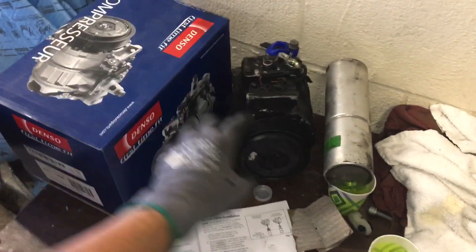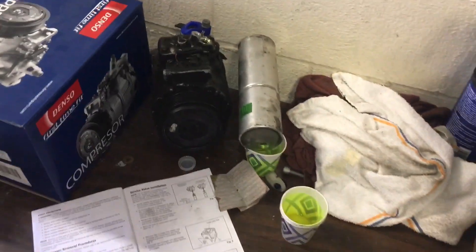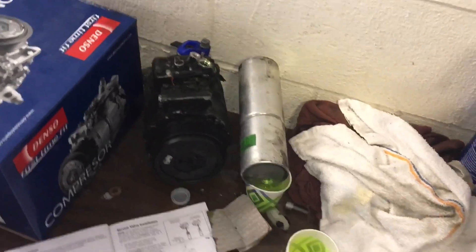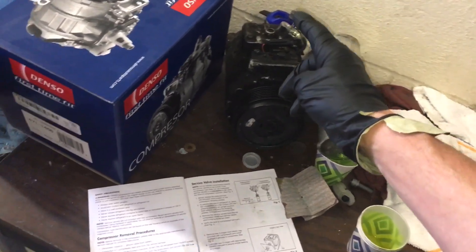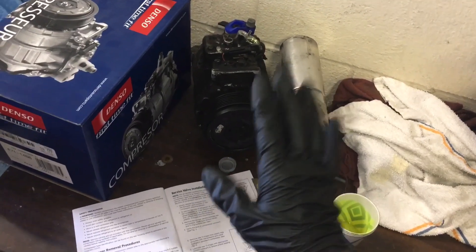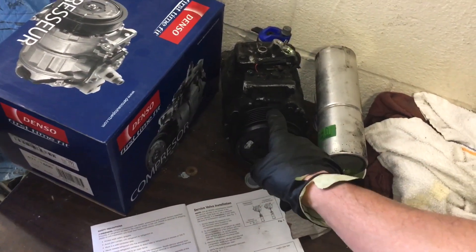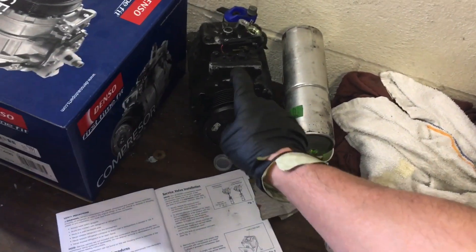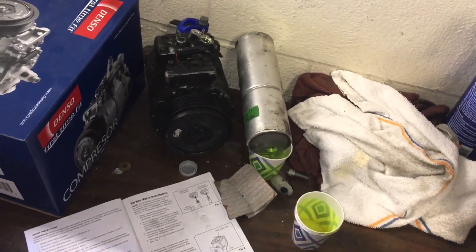So as a technician when you come to do your diagnosis, you might think it's just a blown-out compressor and throw on a new one. In this case, if it was leaky but there were no metal particles or piston ring particles and everything was still clean — they got lucky, caught it early, and didn't try to just refill and keep driving. Change the dryer because you're changing the desiccant material every time you open the system. Now, if your guys did not read and you grab a compressor that has a full charge of oil — say six ounces — but the evaporator is also filled with oil because there was basically no oil in the old compressor, you've nearly doubled the charge of oil in the system.